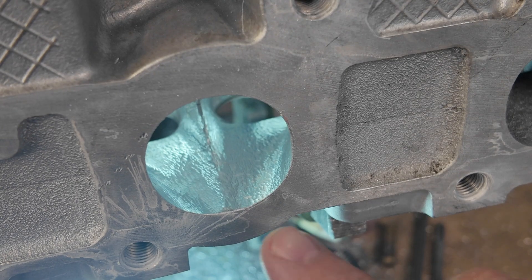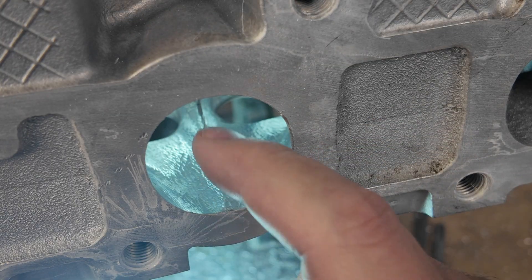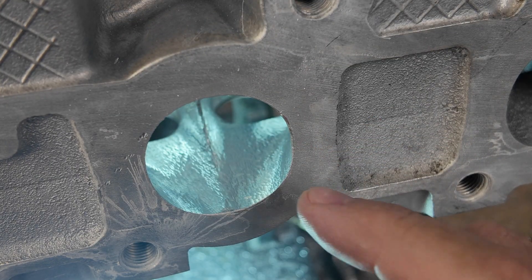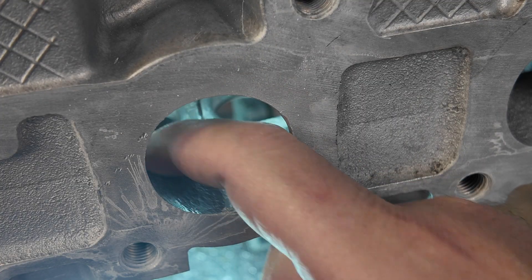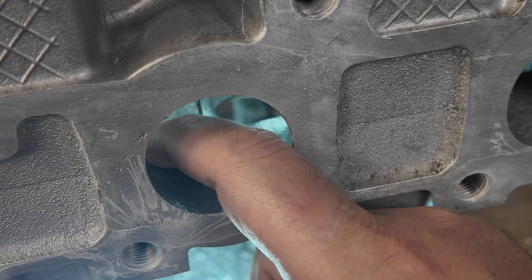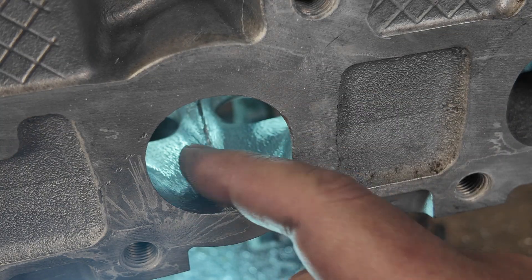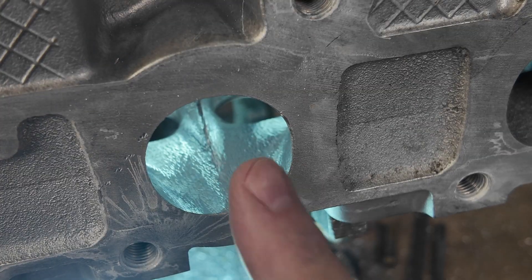I also always attack the short side from both sides. A lot of times I like to do the floor first — not every head, but I like to do the floor first because I don't want to flatten out anything that I would make into a turn. So I just kind of sneak up on it, then I actually shape the turn from the turn side, and then I blend everything in from the port side.